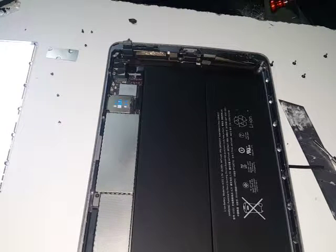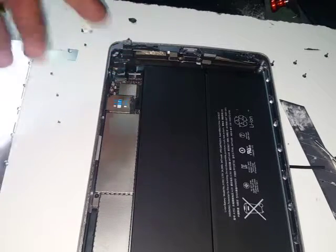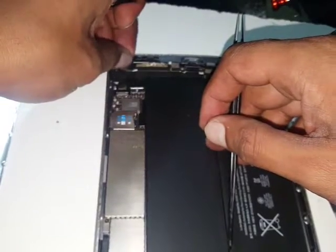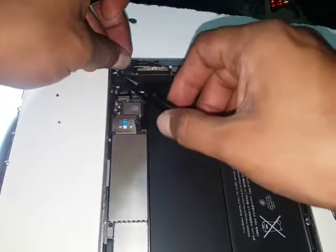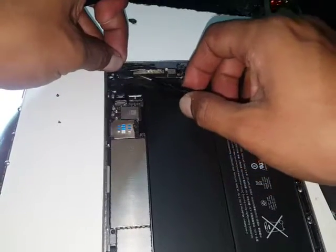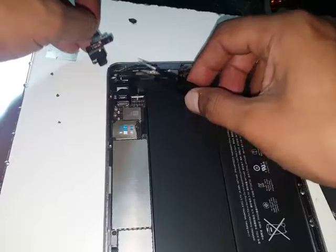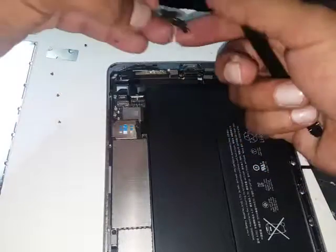Let's go through the reassembly procedure. I don't have a new touch with me right now — I just wanted to open it to get it ready for repair. First you put the digitizer onto its plug. In this case we already cut the old one, so remove that nicely and slowly. The LCD connector is gone; there is the touch digitizer clip. If it's stubborn, use the heat gun.